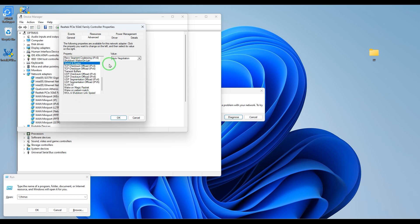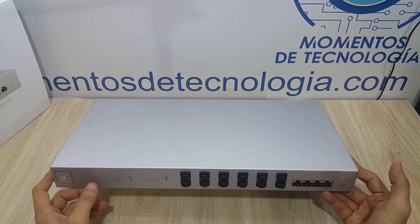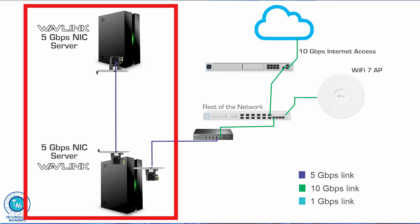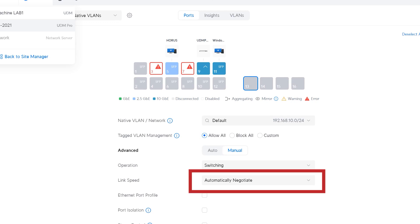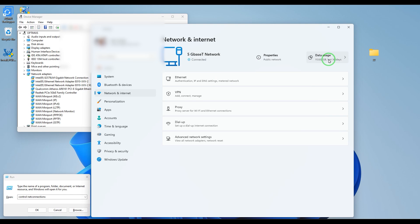At the start, link speed is the setting you'll want to check first. Not all switches negotiate at 5Gbps, so you'll want to verify both the driver settings for speed negotiation and the switch configuration for that parameter. In my case, I had to limit to 2.5Gbps because my switch is not capable of 5Gbps Ethernet. However, I was able to link at 5Gbps using a 10Gbps networking adapter. Once you set the switch to the correct negotiating speed and configure the driver's advanced tab, the link will come up at the speed you choose.